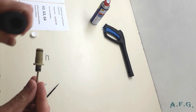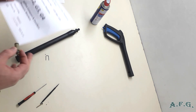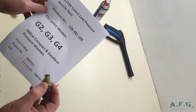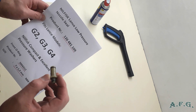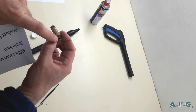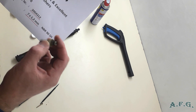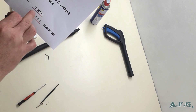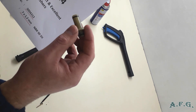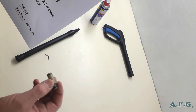As you can see, it looks like this. It's the part I mentioned at the beginning — product number 126-481-109. You can either buy the whole plastic part with the two O-rings on it. Usually leaks appear when this O-ring is worn out. You can buy the whole part — which I recommend — or just the small O-ring, product number 300-431-2. I checked the prices and roughly the whole part costs very similar to the O-ring separately, so it doesn't make much sense to buy just the O-ring, though it depends on the country.